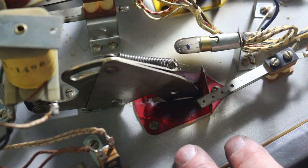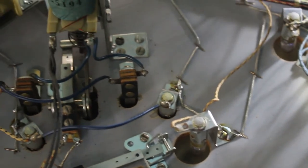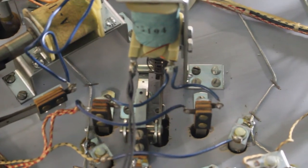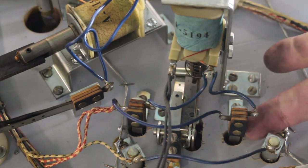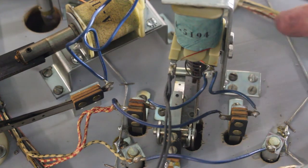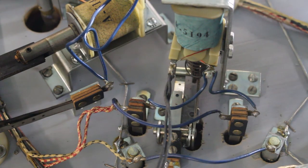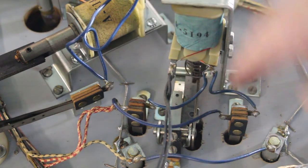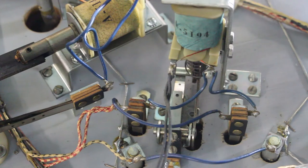I told you how the thumper bumpers work, and on the kickers, on those kickers that are down by your flippers, which are, that's the one we just finished up. Get you set up a little bit, there we go. Now on these, same thing, you have your switches that touches the rubber. It hits the switch. If it's 10 points or 100 points, it clicks once. Clicks once real quick on your scoring reel, and then it kicks the ball, and you have your end of stroke switch, which shuts the coil off. Doink, doink. Just like that. Shoots it back and forth, or shoots it up.